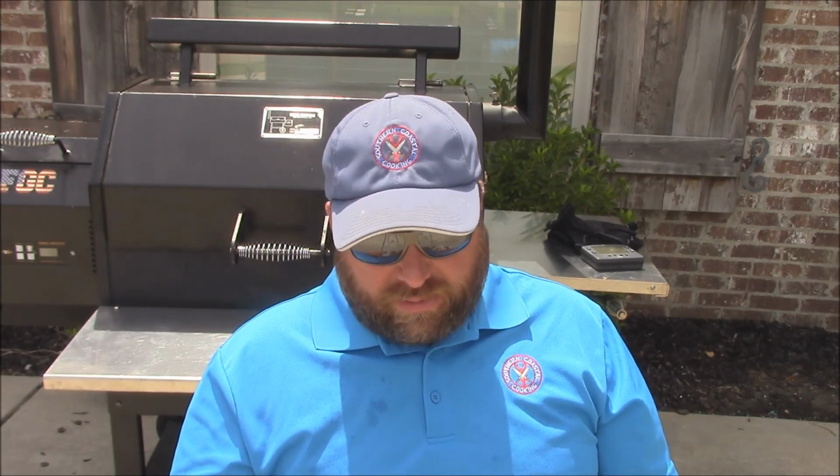They provide me a can of spray paint or whatever, and I've talked to a bunch of guys in the industry, in the grill industry, not just pellets, but all around. All of them say that on grills, on barbecue pits, paint flaking is a big issue because you're dealing with metals expanding and contracting and stuff like that. Now, with that being said, if you go to the all stainless one, you don't have that issue. But the deal about stainless steel, you've got to get such thick stainless steel to hold the heat in like these. So your price is going on up there, okay?